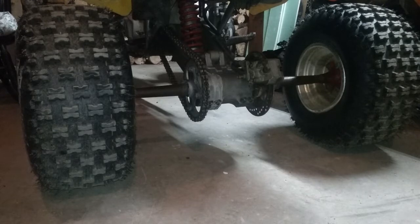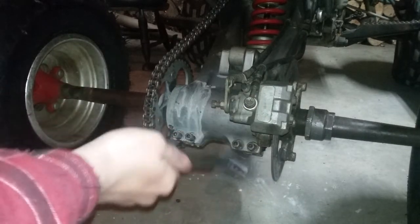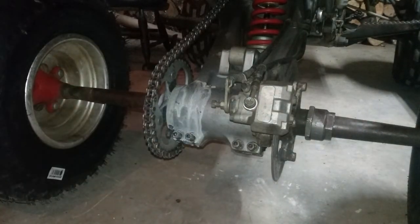The final step is pretty self-explanatory — just reverse step one. I normally go left to right when loosening the bolts, so now just go back and tighten them all up. Then ride your wheeler around a little bit and feel the chain. If it feels too tight or too loose you'll now know how to go back and readjust. This video is for anyone trying to figure out how to tighten their chain — whether you're new to racing quads or switching over from a different brand like Kawasaki, Suzuki, or Polaris.